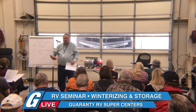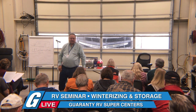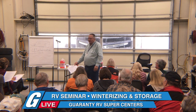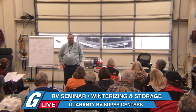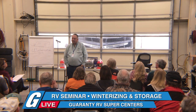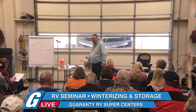The last four are things that we do: pull a fuse, put your name on it, sign. That's what we do. This is, I guess, for the techs. You don't need to sign it and date it and pull the fuse. You know you did it. The only issue is if you do winterize, when you de-winterize you need to make sure your bypass is back in the normal use position, where the valves are in the directional flow.